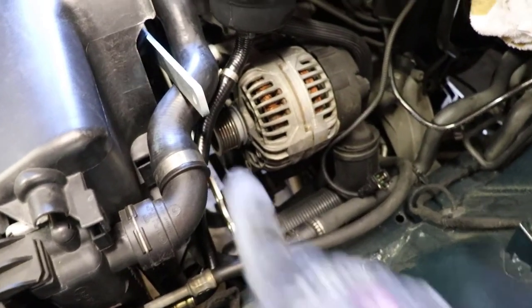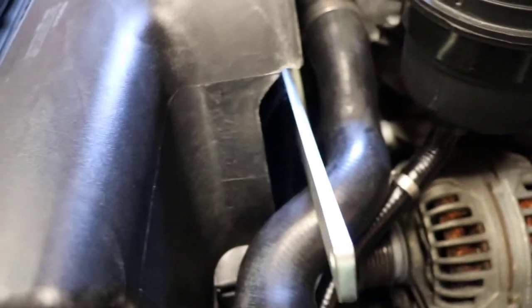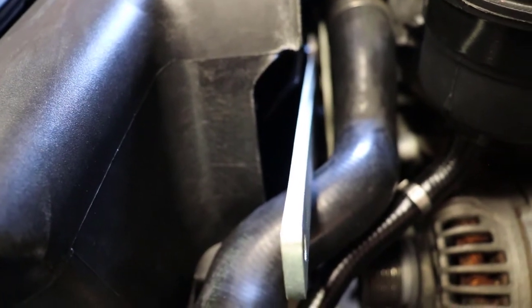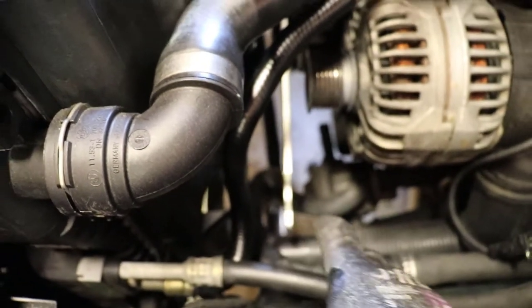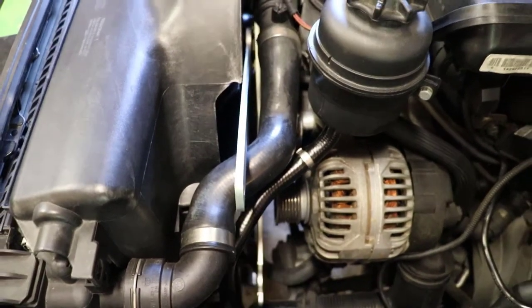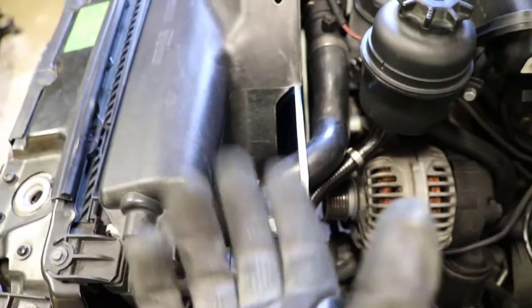In here I have the 32mm wrench on the big nut of the fan — it's way down in there. Down here we have the tool to hold the nuts that are on the clutch. You have to hold those stable while hitting it with the 32mm really quick and it will break loose. I'm going to loosen it all the way and pull it all the way out.